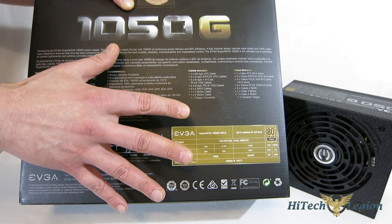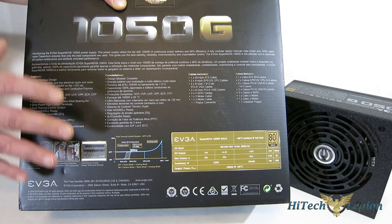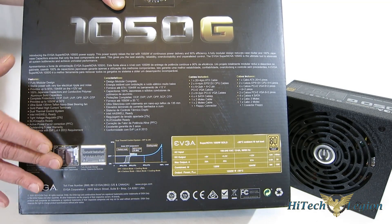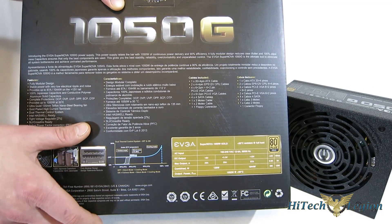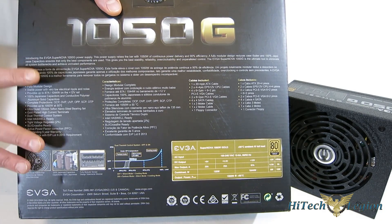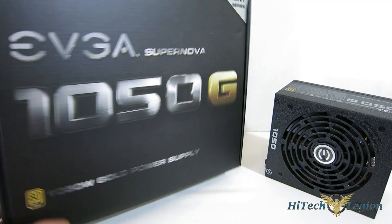It's a much nicer design than an AC-to-DC converter on the minor rails. Moving on, it uses 100% Japanese capacitors throughout — Nippon Chemicon — so no skimping there. It's remarkable what EVGA has done using top-quality components to achieve 80-plus gold and keep the price where it is. There's a 135-millimeter Teflon nano steel-bearing fan for very quiet computing, six-way protection circuitry, a 100,000-hour MTBF, and a 7-year warranty. EVGA customer service is second to none, and they stand behind their warranties like nobody else.